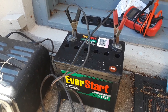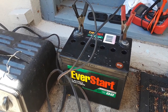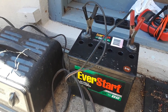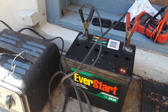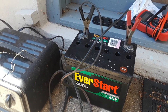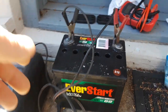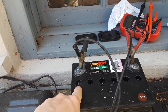This trick works best on batteries that are just starting to die — ones that are a little weak and holding in the 11-volt range came back no problem. Ones that are really stone dead, you might not have as good a success rate. But again, this here is an eight-year-old battery that was only at 1.25 volts with one completely stone dead cell, and I even brought this one back.